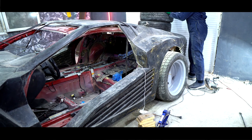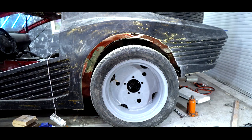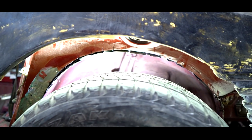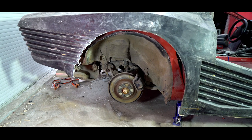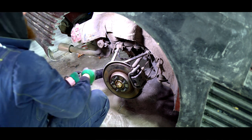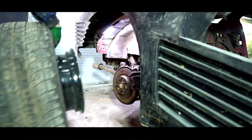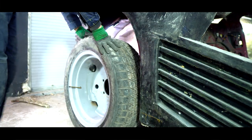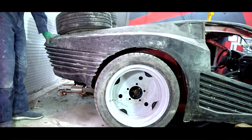This can be solved by cutting off the spring coil or buying springs with lowering, or in extreme cases carrying a couple of cement bags in the trunk. I made the same thing on the other side. Only I checked how low the body with a standard suspension can be lowered on such wheels. I removed the shock absorber strut for the check. The suspension evenly allows the arch to lie on the wheel. There's even a small damping action reserve.